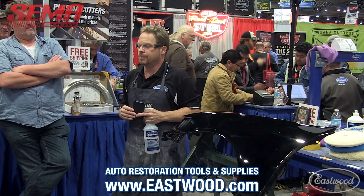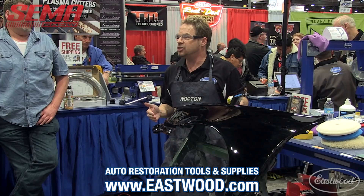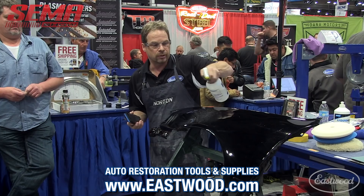When I started sanding and buffing at a shop in Los Angeles called Alejandra Porsche, we weren't allowed to run the hose. The solution to that is a water spritz bottle from a home center. I've got a couple of drops of dishwashing liquid in this, and I'm spritzing my panel down and my paper. I'm not just randomly sanding — I'm blocking.